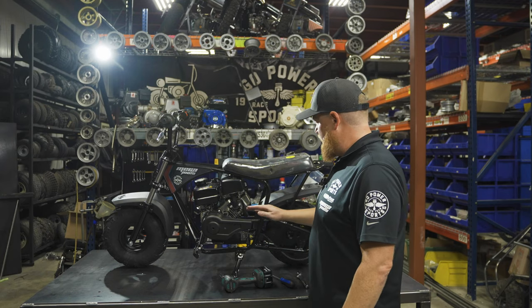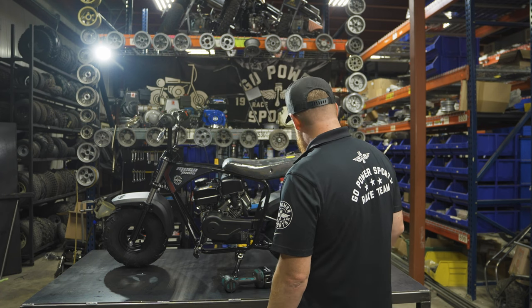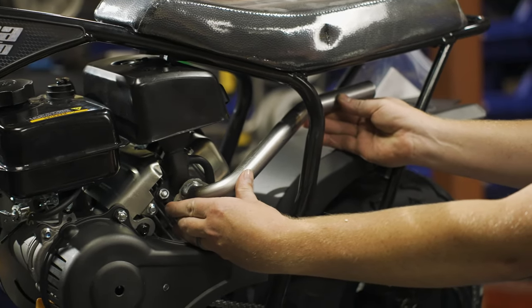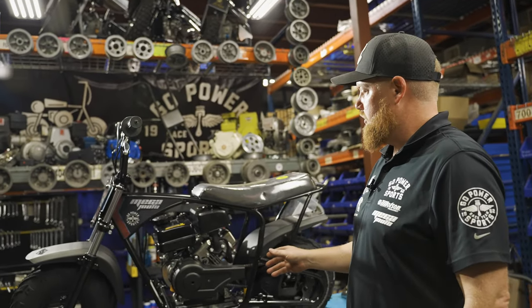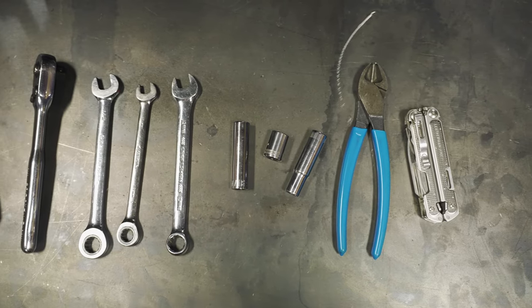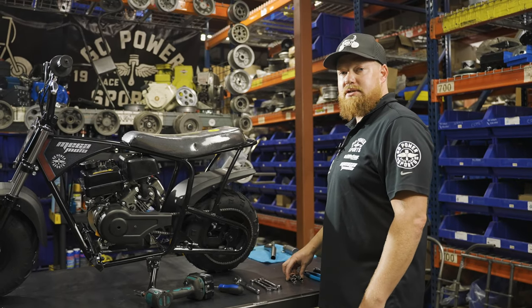That finishes up the 98cc on this Megamoto 80/105 roller. As you can see it goes on very easy — the tilt mount gives you plenty of adjustment, the chain is super easy, you can take all the slack out, and the chain guard looks great. The skinny center-exit header pipe comes out right there so you can run a little muffler on the end — it's pretty much centered between the fender and the frame. For this build you just need a few tools: some sort of cutters, pliers, a 10mm, 13mm, and half-inch wrench, a ratchet or impact, a Phillips head screwdriver, and a standard socket set.